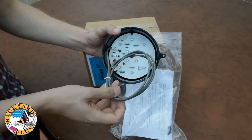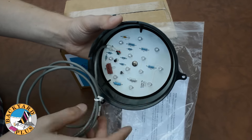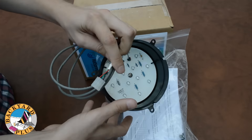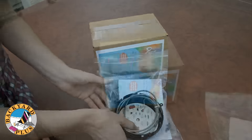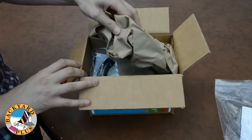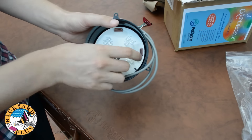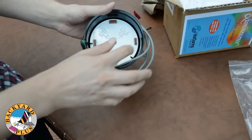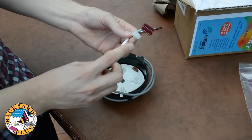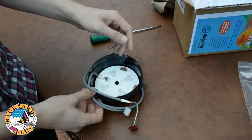The blue light comes in a plastic bag and contains only blue LEDs. It has just one 3-pin connector to power it. The multi-color light comes in a box and contains several groups of 3 colors of LEDs which can be controlled to produce a myriad of different colors. This light also has two connectors: the 3-pin connector for power and the I2C connector to control the color changes.